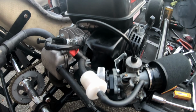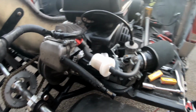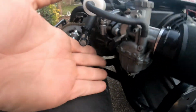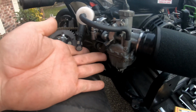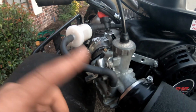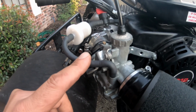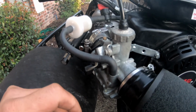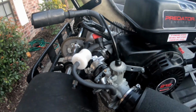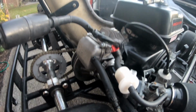So yeah, I guess the next video will be adjusting the carb. I changed the air fuel ratio underneath to 2 turns out. I believe I'm running a 115 jet in here right now. Oh, and I gotta adjust the cable too, or the needle up and down to where it's in the middle, so everything's middle where it should be. Then run it, check the spark plug, and go from there.